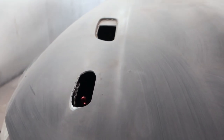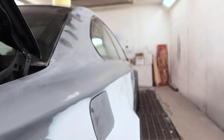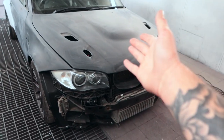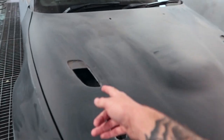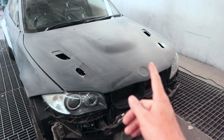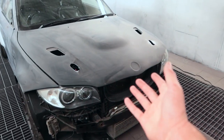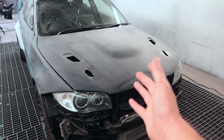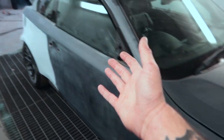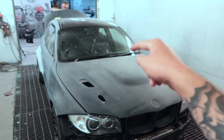It's a couple of days later. I've left the car with Luke — he's the chap that did the rear arches on the one series — and he's going to be painting the car. He's already started prepping. Most notably, he has cut holes in the bonnet for the M3-style bonnet vents, and we're also fitting aero catches. It's a fiberglass bonnet and the aero catches will help it fit better at the sides and make it safer, since a single central fastener on fiberglass isn't ideal. He's also stripped off all the indicators, wing mirrors, and door handles ready for a clean paint finish.